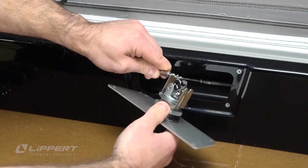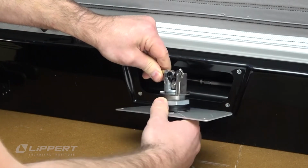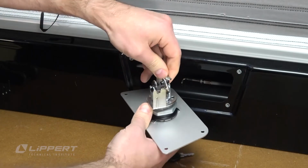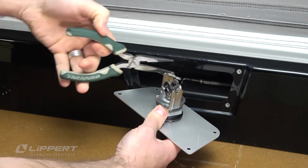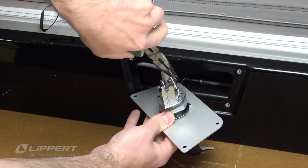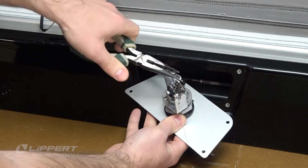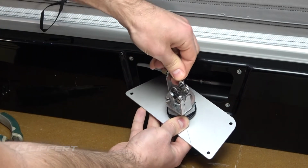Install the lower drive cable first at the actuator bracket. Work the retention threading through the bracket until the drive cable hook can reach the lock cylinder retaining eyelet. Rotate the hook, then mate it to the eyelet. Rotate and snap the lower drive cable retention clip into place.